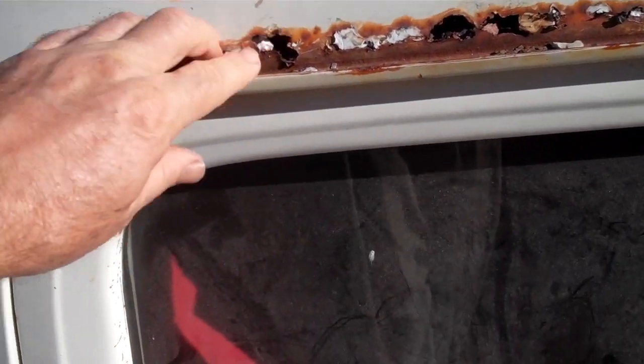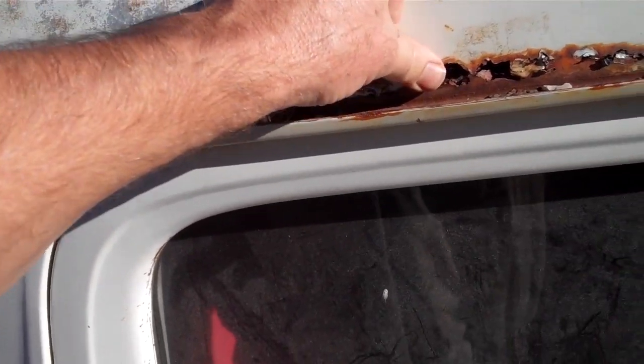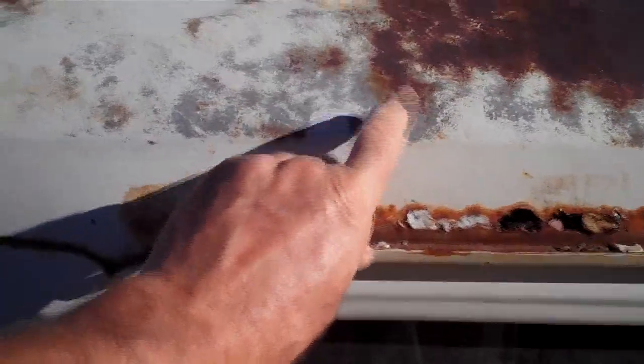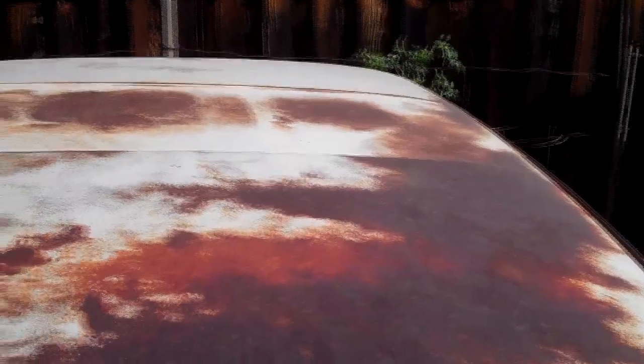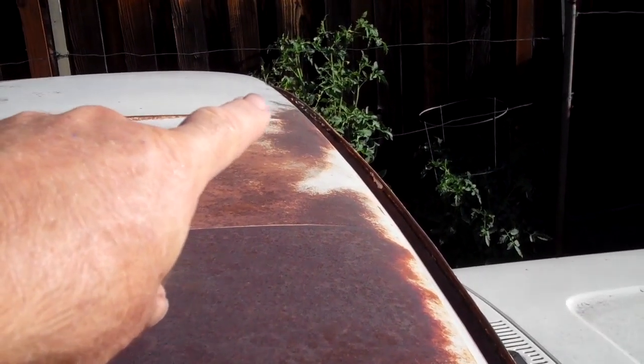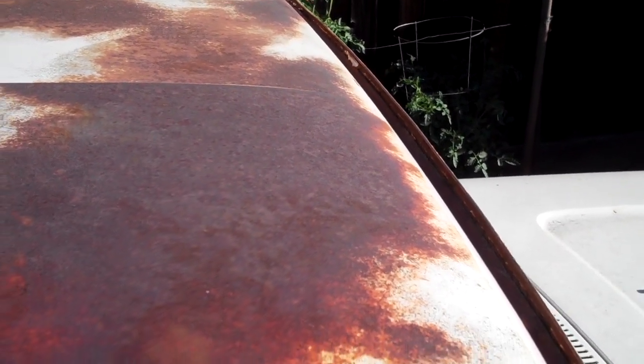This is my next project. As you can see, I have some rust through here. I left the seam sealer in there too long and it just held moisture and rotted right through, which is a bummer. The primer is gray — this is the cab, it's not rusting through or anything, I just let it go too long. Over there you can see the drip rail, it's got some rust through, pretty bad shape.